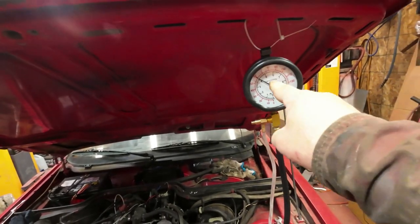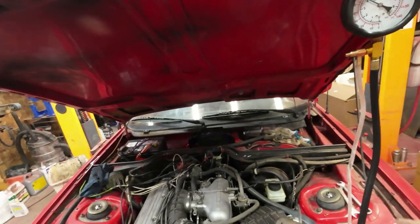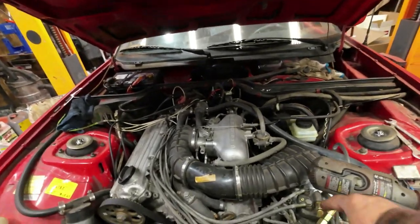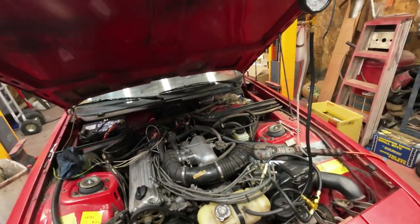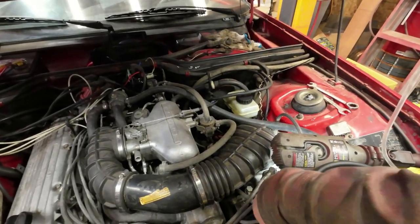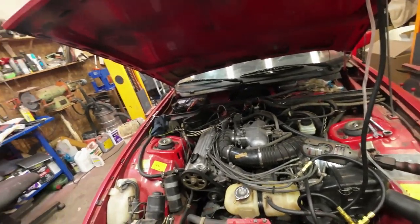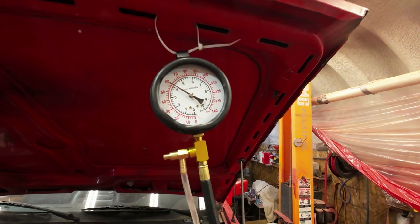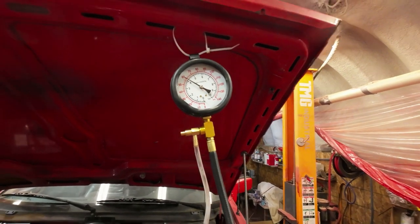So now there. The system pressure is at 4, which is low. Now I have to solve that by perhaps putting some more shims in here, because this thing here allows the pressure to go out through there. So that's what we've got to check next. Yeah, now there. Most I get out of it is 4.5, 4.2 bar.